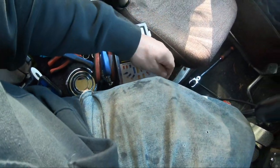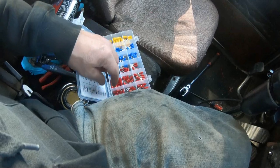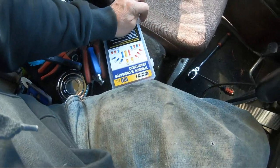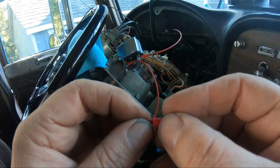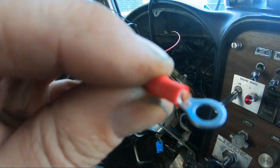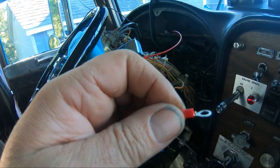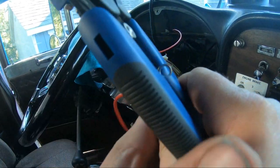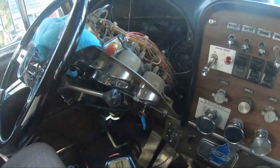I'm going to my goodies. I'm planning on putting new seats in this truck and everything — until the day they tell me I can't drive it in my state, then I'll retire it. I like to twist the wire on and make sure it comes out a little bit onto the terminal, then give it a good crimp down. Tug test — we're good.